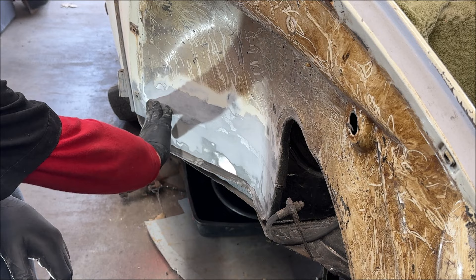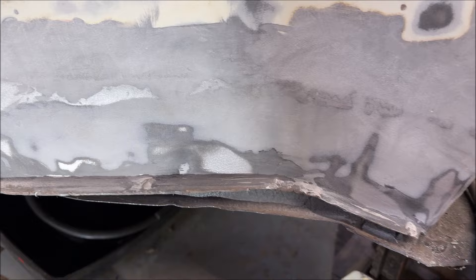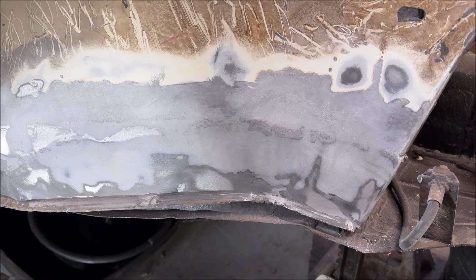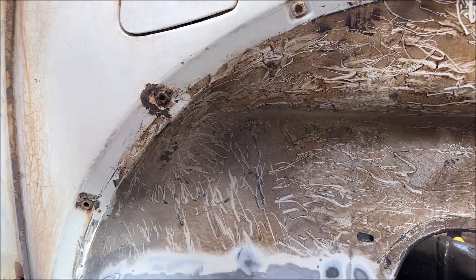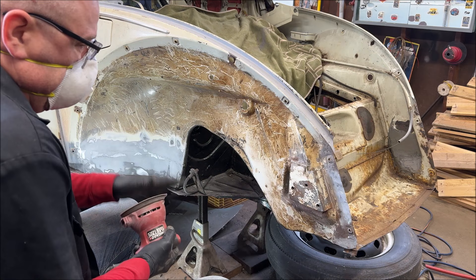It is hardening up quick, and you can't really tell your mix because a lot of hardeners are blue or orange and you can simply tell that way. See how nice that spreads on — it's like using Rage. The hardener on this is clear, so it isn't like you're looking for a color to confirm it's mixed in good enough — you can't do that with this unfortunately. I'm only going to have to use one coat, and I'll probably use Rage after if I need to, but we're putting rust bullet over it so either way it's going to come out pretty nice.